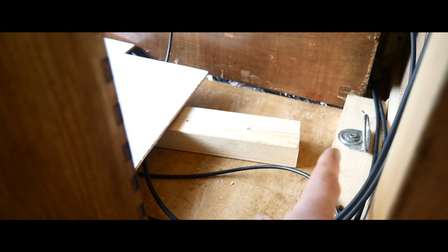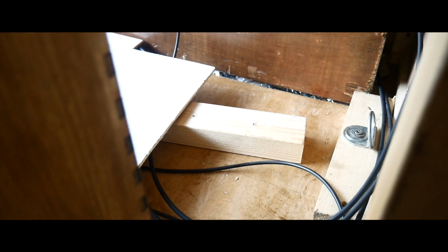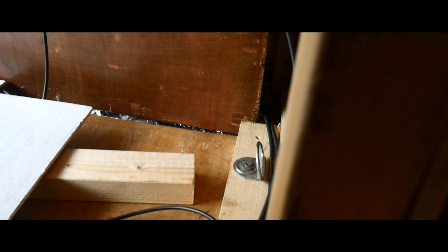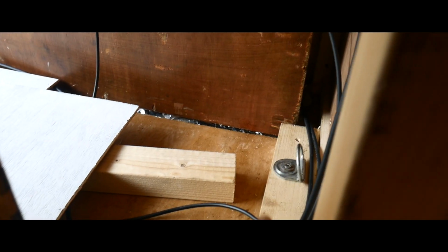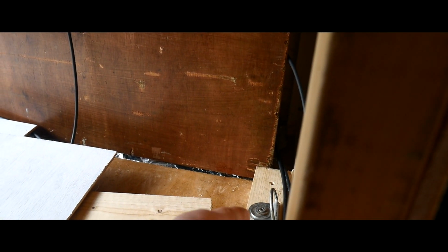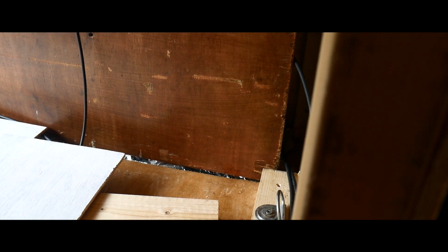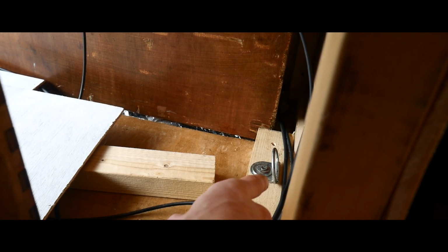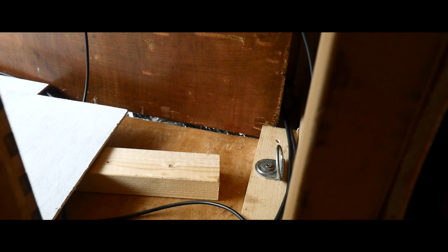I'm just going to run that, because once I put these boards on, it'll obviously be hard to get to that. Another thing I've quickly done is put some massive screws and a small bit of CLS, this end, into the floor, and as far through as I can. It doesn't specifically go into the batten, but I just use some big screws. And then lots of washers and a big screw as well into this tie down point. And these are really good. They came with the van, and for some reason I only kept 2, which was silly because I need another one because I've used one for the water butt. But these are really good for batteries, water butts. So when you're taking apart your van, if you've got these, make sure you save them because they're really useful.